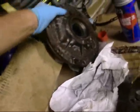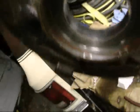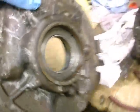yeah, my transmission rebuilder. Oh boy. This is the pump cover, and look at that bushing. It's junk. The torque converter rides right in that bushing, and it's worn out garbage. Yep, so I don't have a new one. I don't know why. I should have gotten a new one. Went through all my seals. And I've got this bushing, which is similar, but not the right one.